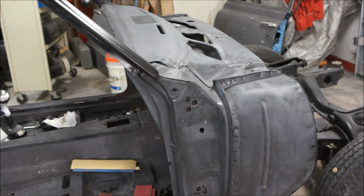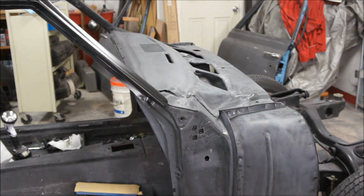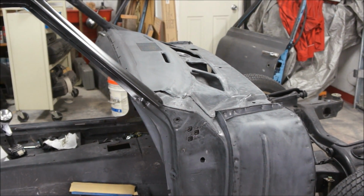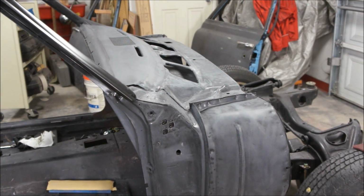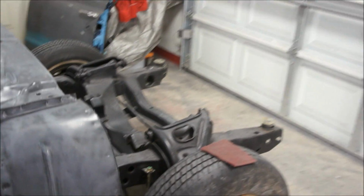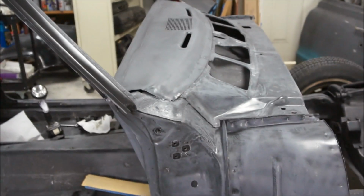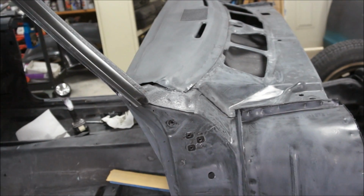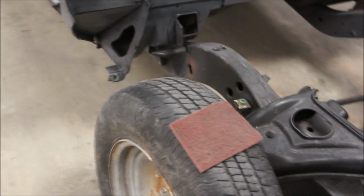I don't really want to take a chance, so I'd rather go ahead and block it down to 500 since it's going to be black. I've never, at the shop, I don't know that we ever took it down that far unless it was a metallic. Usually we went to 320 and then we sealed it and then we shot it. I've never heard anybody go, oh look, there's a Scotch-Brite scratch, or there's a 320 scratch. Usually it's a 180 or an 80 or a 40 scratch or something like that. I almost never see that type of fine scratch.